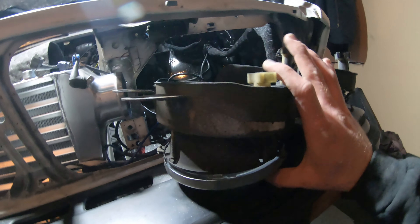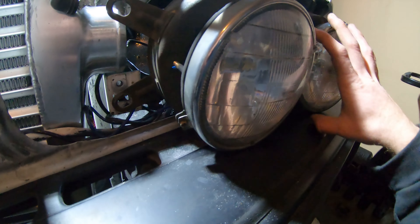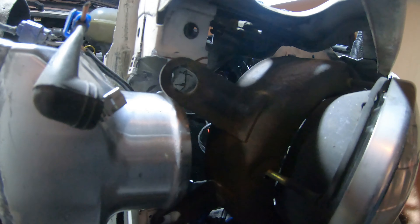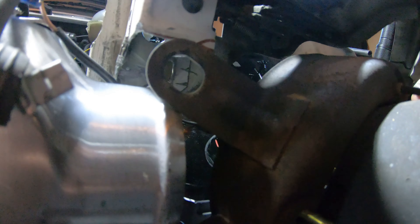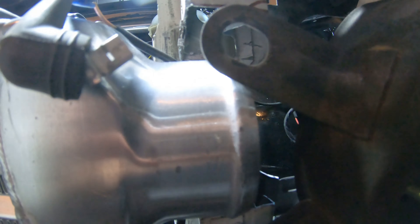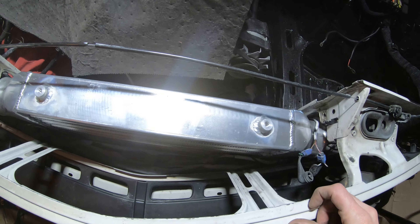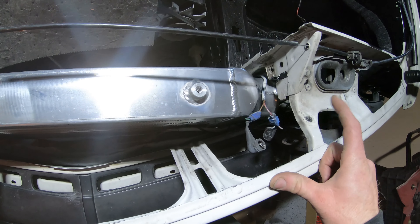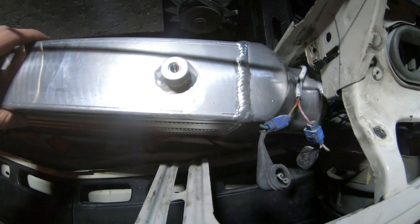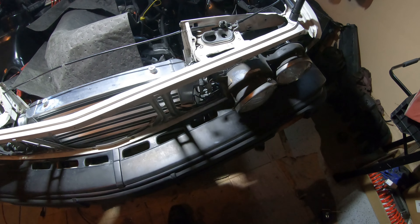The next obstacle is going to be carving down this headlight housing a bit. I pulled the adjuster screw out — that's just why that's moving — but we're going to have to cut down basically from there, get it down pretty narrow, cut this bracket arm coming off, a little bit of trial and error, and then get it to remount and have this guy clear back there. After that I'm going to work on how I'm going to mount up a bracket for this guy. Might relocate the horn, see if I can use the threads right there. Maybe bend some brackets that come up and over, go across, hold this guy up, and see if we'll need them on the bottom or not. We'll start cutting that out next.